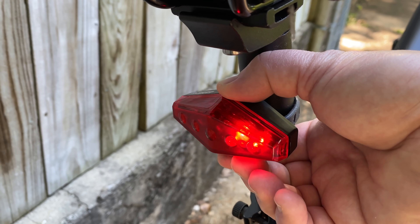Hill climbing is so casual on this bike that while editing the footage I had to look for recognizable terrain features to tell which clips were hill climbs, because everything looks flat on camera. But trust me — what I'm riding is a lung and leg burner — and the difference is I reach the top without being winded, get right back up to speed, and right back to fun. The battery rattle you're hearing — that's because it's a semi-integrated battery, easy to resolve with a strip of foam. If I owned this bike I'd put 720mm bars on it and ditch the stem for a shorter one.